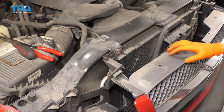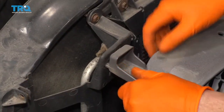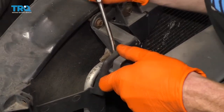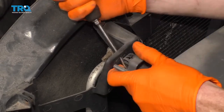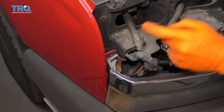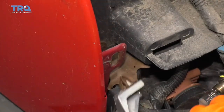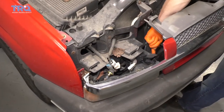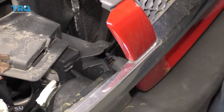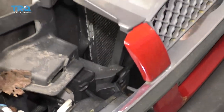It'd be time to get the grille off of here. To do that, if you look along the backside, you're going to see these little tabs that kind of hold it in. There's a couple of ways you can get these off. You can use a screwdriver, press down on the tab, and then draw it away. Or if you're dealing with one of these sideways clips, it might be a little bit harder with a screwdriver, so you could also use some needle nose pliers — grab right onto it and draw it away. If you look down along the bottom, there should be an area secured with one of these tabs as well. It's a little bit smaller. Go ahead and get that off of there, and then we'll do the same down the line.